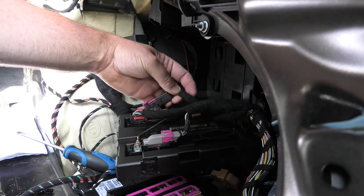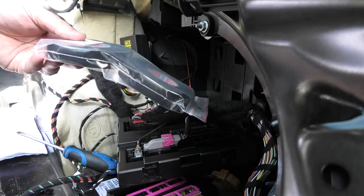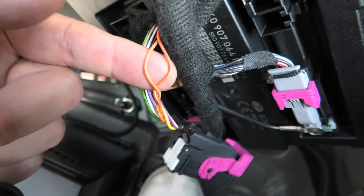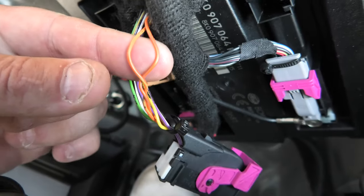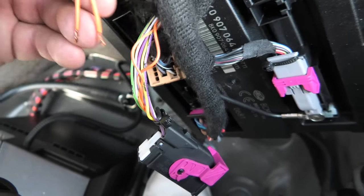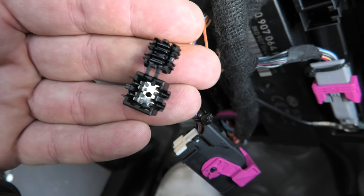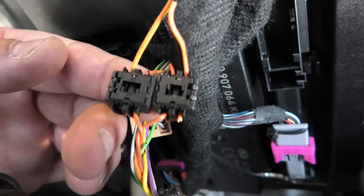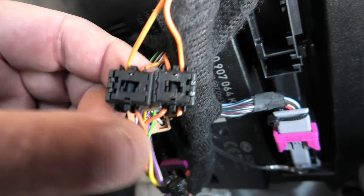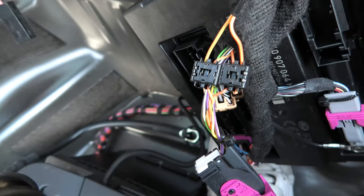When you look at the manual and they refer to the black 32-pin connector, the one they're referring to is the top one. We're going to tap the cables into that section — simply unclick it and pull it back so the connector comes out, exposing the orange cables. Strip back the black tape; I've got new tape to re-protect it and wrap the replacement cables in. We've exposed the two wires needed: orange-and-green and orange-and-brown, which connect to the matching orange-and-green and orange-and-brown from the loom using crimp connectors.